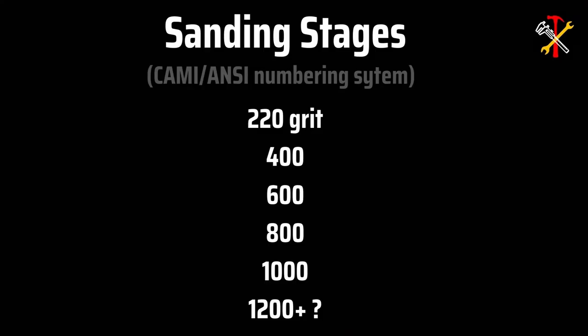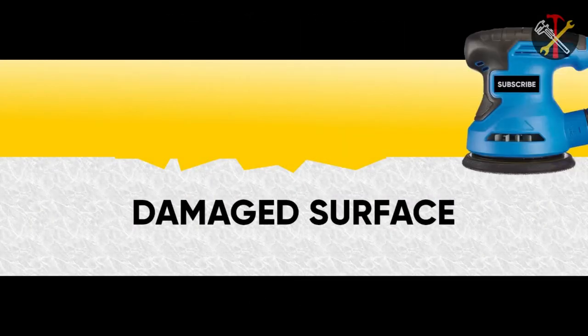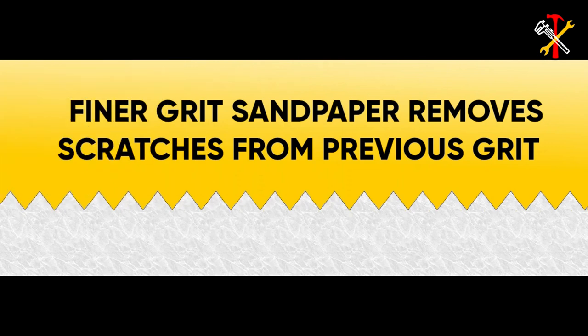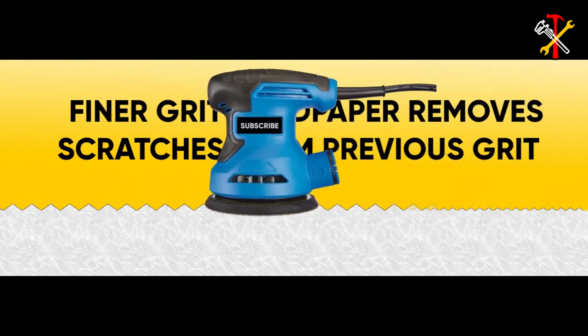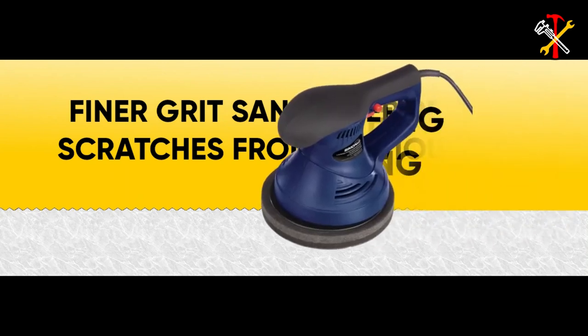I start with 220 grit paper, but you could go with something more coarse, maybe 120, if it really had deep scratches. The first stage of sanding will use the most time for this work. That's where you have to remove all the corrosion and scratches, at least as much as possible. Each step after the first is really just to remove the scratches from the prior step, making those scratches finer and more shallow and less visible.